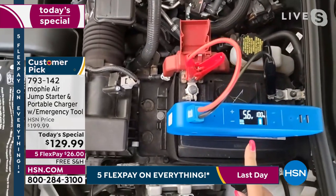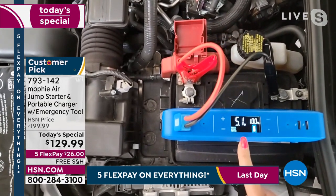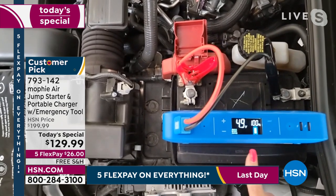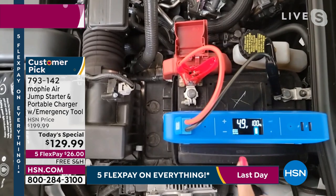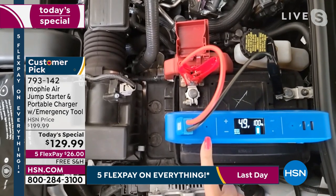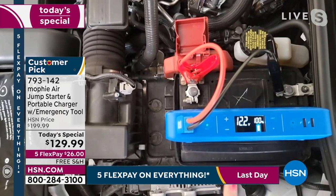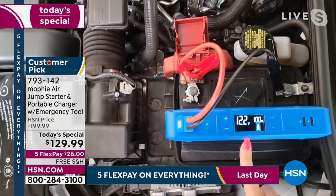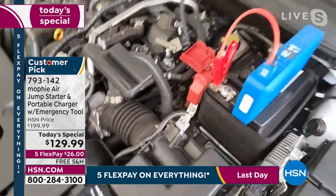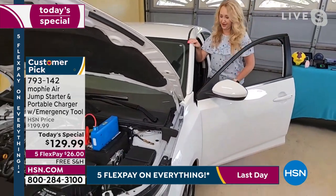So as soon as I hooked it up, I didn't even touch anything, and it's already giving me a diagnostic readout of the voltage of my battery. Now, I didn't know this until the team at Mophie taught me, but anything less than 12 volts is a dead battery. So this one's really low. I'm going to tap the button right here. The blinking green light is processing through a series of safety checks. As soon as it goes solid green, you can see we're over 12 volts. So, Tamara, this has already delivered the power that we need to be able to immediately start our vehicle.